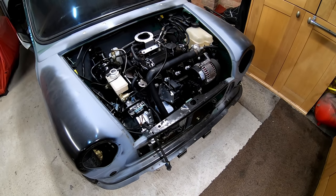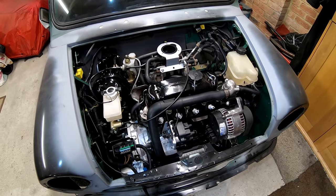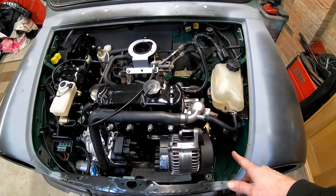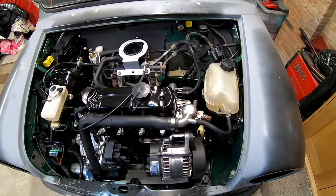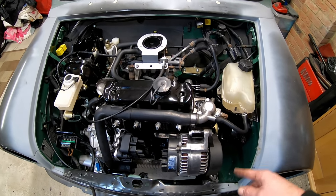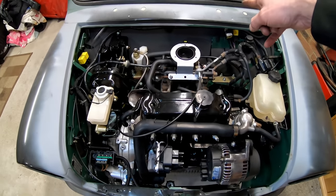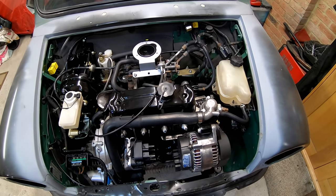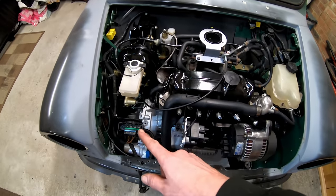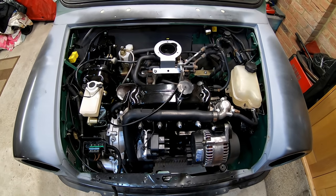So I think that concludes this episode. The engine bay's starting to look like a typical MPI engine bay again — really cluttered, little bit messy. There are a few bits I can't do at the moment. I managed to damage the bottom hose when I was moving things around while it was running — basically I let the coolant bottle drop and the bottom hose rubbed through on the water pump pulley, so that's cost me some money. I haven't got the wiper motor in yet because it's still got to be painted and the bits have to come out — that'll probably go in afterwards, which is a bit of a pain. There's still more stuff to fit under there and the radiator at the front, but we're getting there — it's starting to look like a complete engine bay again.